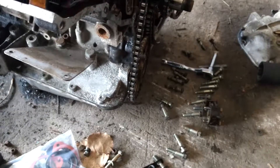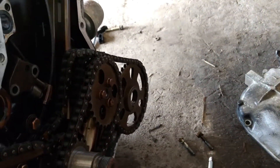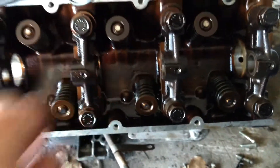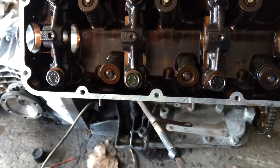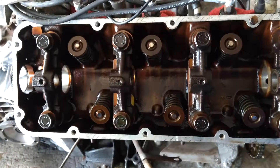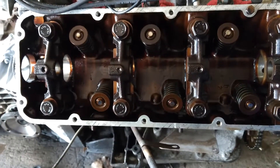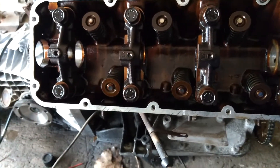You are going to have to remove the sprockets — they're just hanging there right now. And obviously, as you can see here, there are still head bolts in the engine, and you didn't have to remove those. Because if you remove those, you have to replace them and you have to replace the head gaskets. The head gaskets aren't bad, but the head bolts are like anywhere between $150 to $250. And if it's not broken, don't fix it.